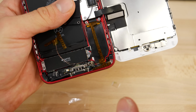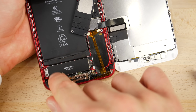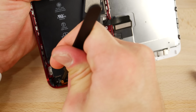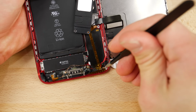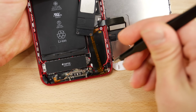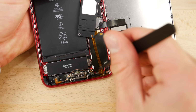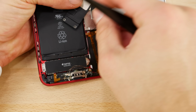So I'm gonna do this real quick. It does take some attention, and I'll show you the finished result. All right, so I just did the left side. Basically, you pop the LEDs in, then nestle the plastic back on top of it, seal the waterproofing seal, and then you wanna go ahead and do the same to the other side. So this needs to nestle into the speaker grill. It's kinda hard to do this when I'm trying to demonstrate it. But you wanna make sure that the LEDs line up with the speaker grills, as there is one LED per speaker grill for maximum effect here.